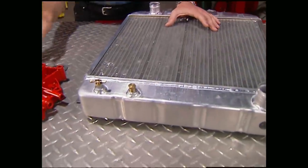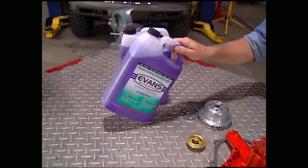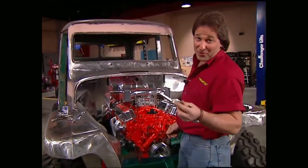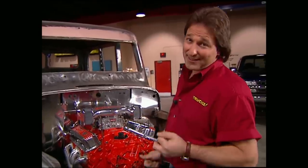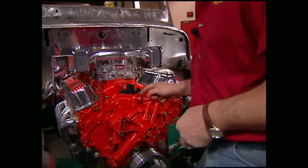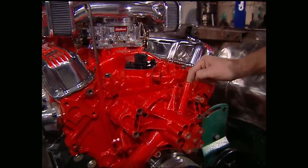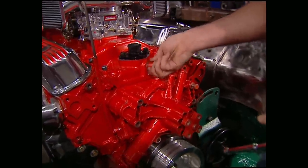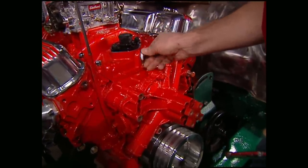This system comes with a radiator, water pump, thermostat, as well as Evans Waterless Coolant. Your ears are not playing tricks on you — this is, in fact, a waterless system, and that's got some definite benefits. In a water-based system like our Mopar here, 30% of your coolant runs out of this bypass and right back into the hot motor — it never makes it to the radiator. With the Evans system, this bypass is plugged, so all the coolant runs right through the radiator.